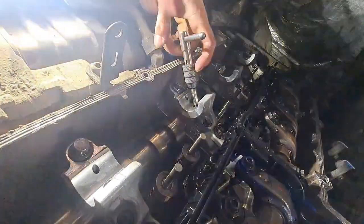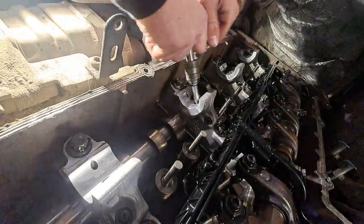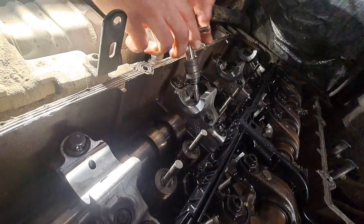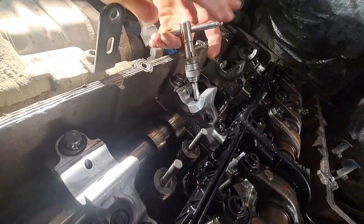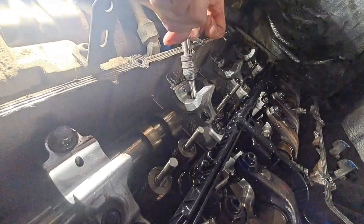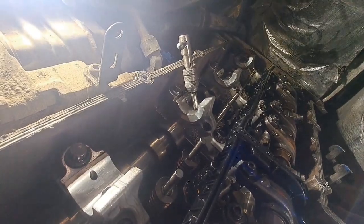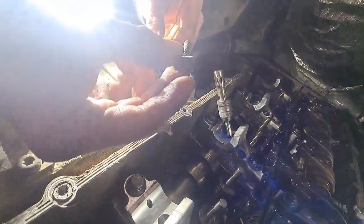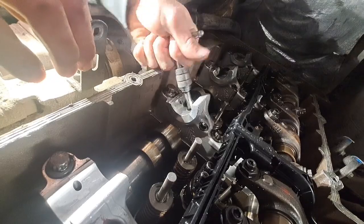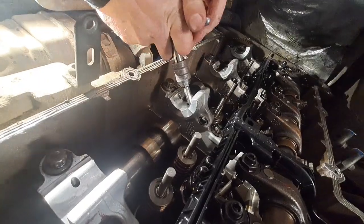Back to my machine deal — I'm not necessarily bragging, just telling you we know a little bit about machine work. I broke one off one of those EGRs to hold a hose clamp lying up there. He's going to finish tapping that one and we will put a time-sert in it and carry on.